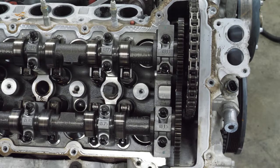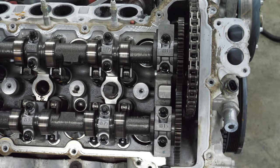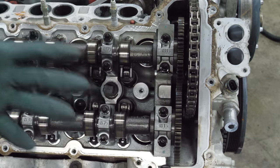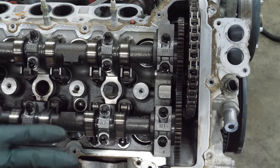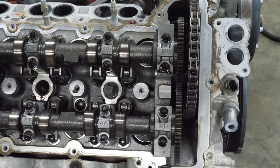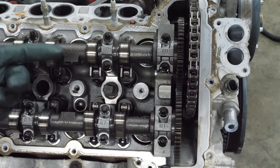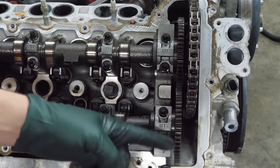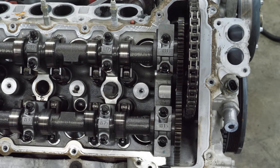It's also pretty interesting the way they drive the cams. The chain drives the intake cam and the intake cam drives the exhaust cam. I really love this simple design — Toyota and Mazda have been doing stuff like this for a long time. Lots of manufacturers have used a single chain or belt to drive one cam which then drives the other. What's interesting is how narrow these chains are compared to most gasoline engines, but they also don't turn the same RPM.